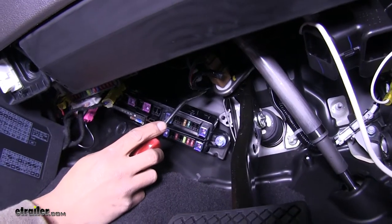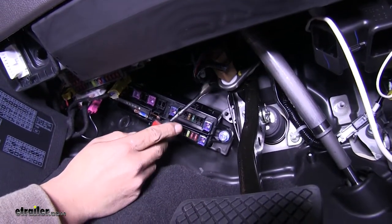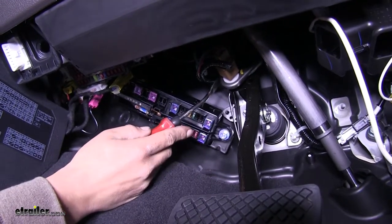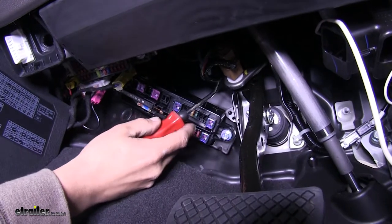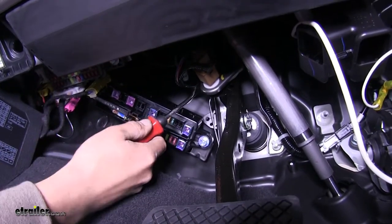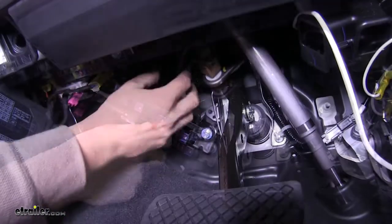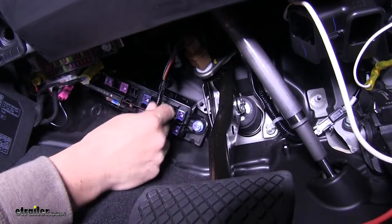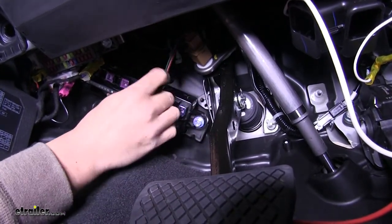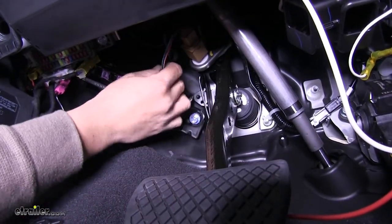To make it a little bit easier to gain access to the wires, look right on the side of the brake switch — there's going to be a plastic clip holding the wires tight. Take a trim panel tool or flathead screwdriver and pop it off. That'll give us just a little bit more room to work with and we can pull some of this wire loom off. Be careful not to damage the wires if you do have to cut it, and be careful when pulling that loom down.